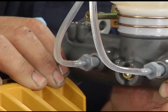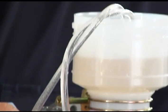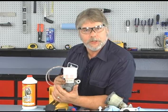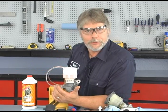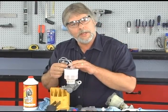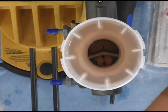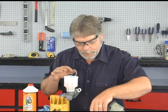As you can see from our bleed tubes, all of our large bubbles are gone, but we still have a series of small bubbles in the fluid — we've basically aerated the fluid. So at this point let's sit here for a couple of minutes, let all the bubbles come up to the top, and then we'll do our final bleed. You basically want to keep repeating the process until all the air is out of the master cylinder, because if you put this on with air still trapped in it, you'll have to force all the air from the master cylinder throughout the entire system before you have all the captured air out of the brake system. Our next step is to go ahead and remove our bleeder — you can see it's dripping from both ports. Remember you don't want the brake fluid to come into contact with any painted surface, so we'll cap up the ports, remove our bleeder kit, reinstall our filter, and at this point I'm just going to leave it at the halfway level until I get it on the car, then reinstall the cap.